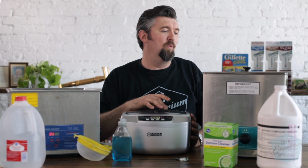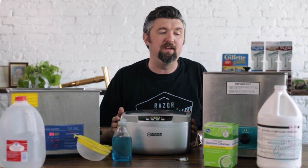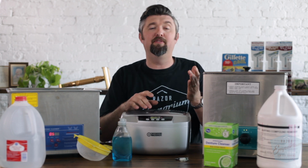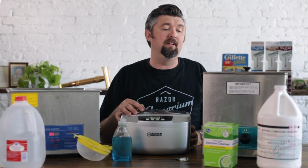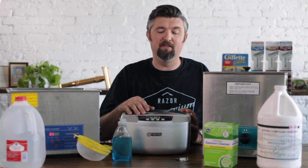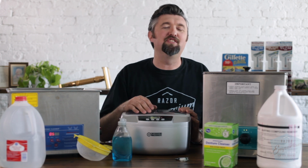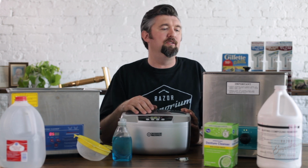One kind of deceptive thing that these companies will do is they'll talk about the power that's being used. I'm not going to try to give you the entire story, but there's power for the heated component to heat the water, and then there's power for the actual sound wave generator. A lot of times the cheap ultrasonic machines will show you a really high amount of power. They'll say 100 watt or 200 watt, but if you read the fine print, or really do the investigative journalism on it, you'll find out that 80% of that is just for the heater, and just a very small part is for the actual transducers. So they're not very effective. You want to have a good mix of both.